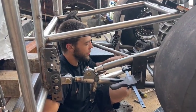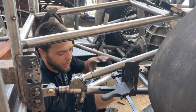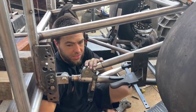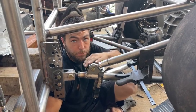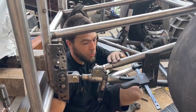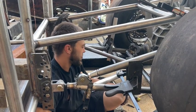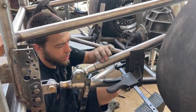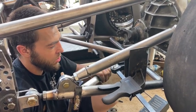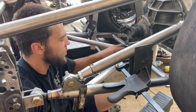By doing so, it keeps this point out of our driveshaft, keeps this area open for our pinion angle adjustment and instant center change. On a ladder bar car set up this way, our instant center change is controlled by the bar angle — the lower main bar has to change angle. On a big tire car you can also move that instant center by moving the upper bar as well.